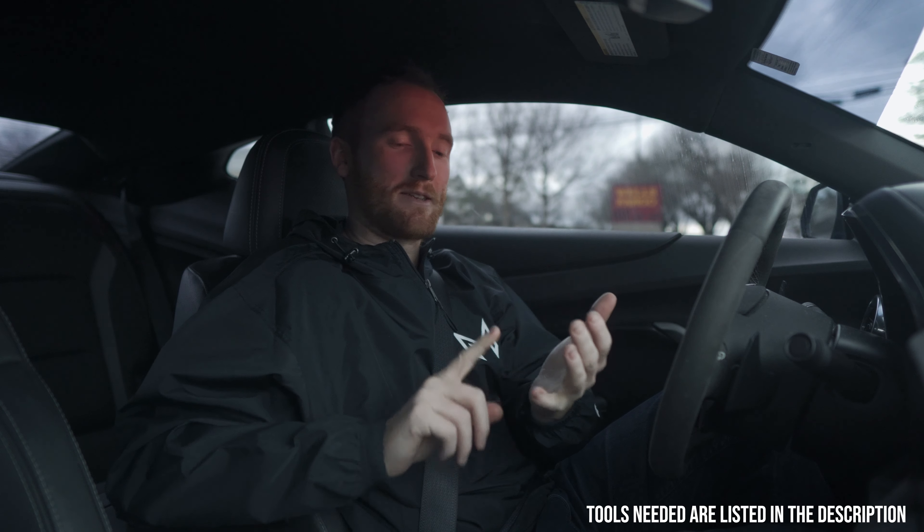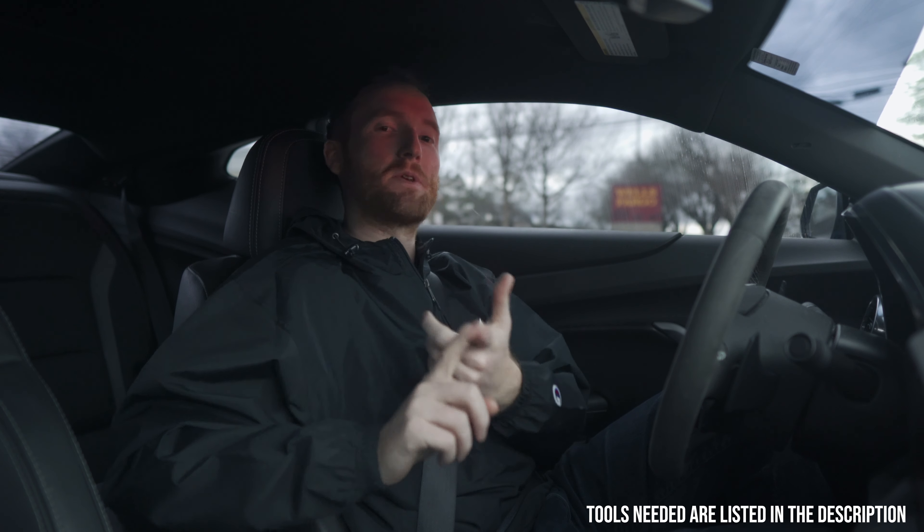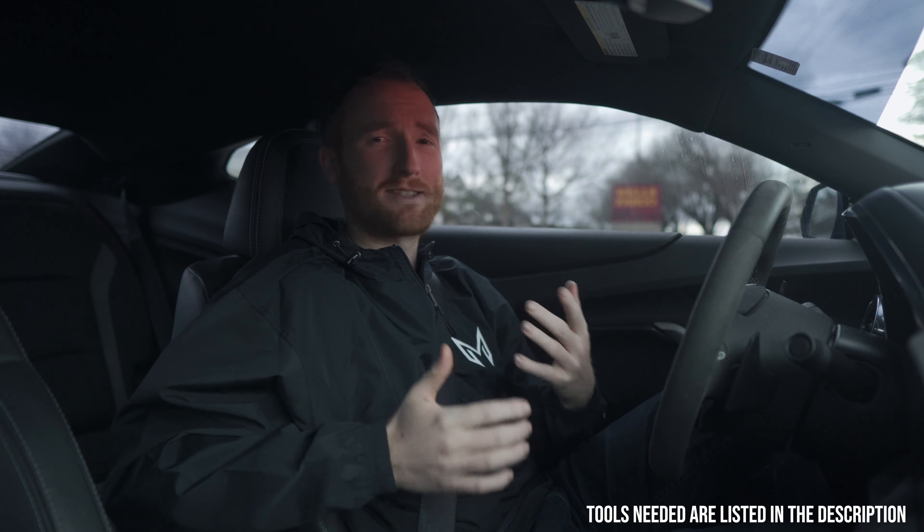All right guys, I'm gonna skip straight to the point. This job should be relatively easy. I'm gonna walk you through exactly how to do these steps. All you really need is a socket and wrench set or impact gun to pull off your wheel, a plastic panel removing tool — or a flathead screwdriver — and a set of Torx bits, I think it's like a T8 to T10, to remove the fender liner. You're basically gonna pop the fender liner off, move the wiring harness, and you're done. Let me show you guys exactly in detail how we got there and then the end result — stay tuned.